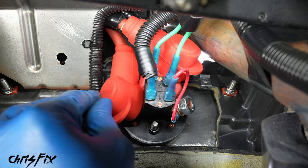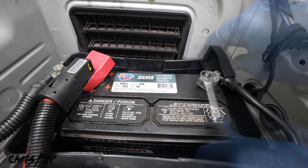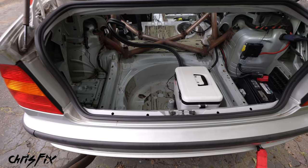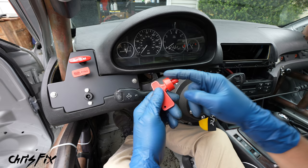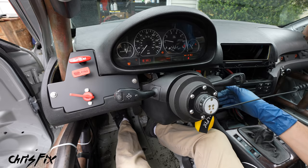And now one last thing — I added these silicone post covers, and these are pretty important. They go over the two positive posts like that, and this will prevent anything grounded from touching this by accident, which would short it out and could cause sparks. The last thing to do is get the negative terminal back on the battery and tighten it down so it's snug. And now our battery is hot. Alright, so with our battery connected, moment of truth — let's go and test out our new kill switch. Alright, let's try it out, let's turn the switch on — and we have power.